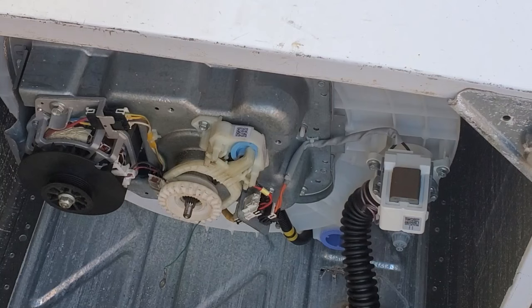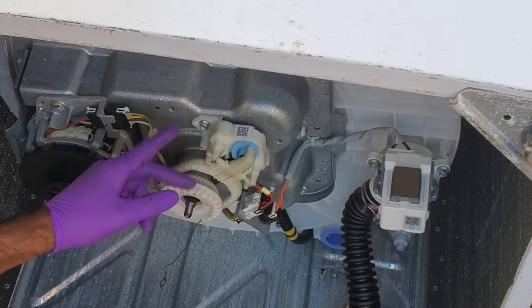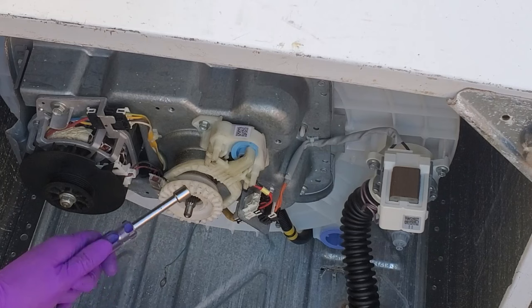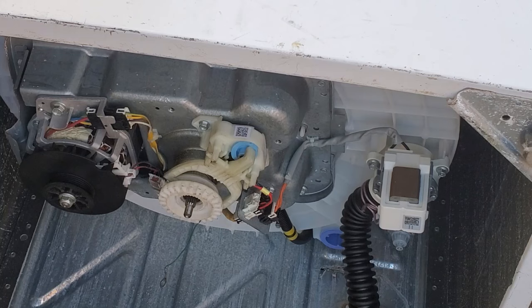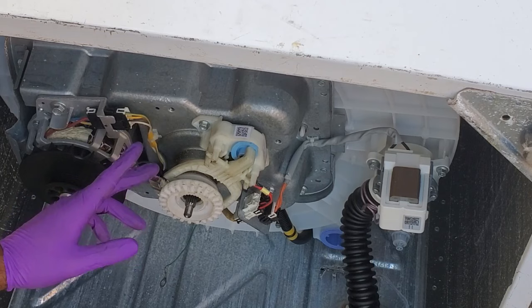The next thing we need to do is take off the mode shifter motor, or the mode shifter itself. I do recommend replacing the entire shifter while we're down here — it's about 60 or 70 bucks. But if you don't want to replace it, you could first try replacing just the clutch and seeing if that works. I've worked on these enough to know that the motor gets weak after a while and it'll do half shifts or partial shifts, and that's what grinds the teeth down as well. If replacing the clutch and clutch spring doesn't resolve the issue, then you'll definitely have to come back and replace this.